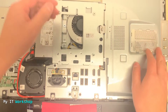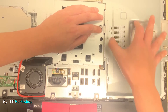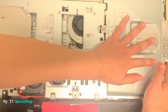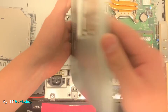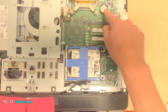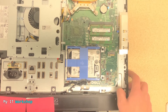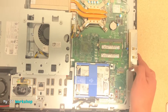Most of the components on this model are on the right side. By the way, I have a video where I remove the hard drive for this model and replace it with an SSD — I'll leave the link in the description. You press with your fingers, thumb, or sometimes a screwdriver to remove the inner cover. Once removed, we can see the RAM, the CMOS battery, the hard drive, and an M.2 slot where you can put an M.2 SSD if you need more space.